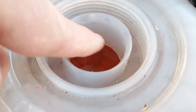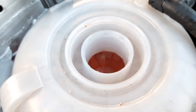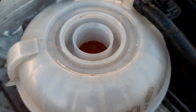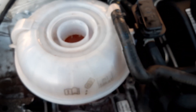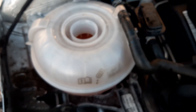However, it sits just down inside there, and they have been known to burst. When they do burst, all the little silica crystals will clog your heater matrix up, and that can give you a twelve-hundred-pound bill. So if you're prepared to change the coolant every five years or so, you can remove the silica bag completely.